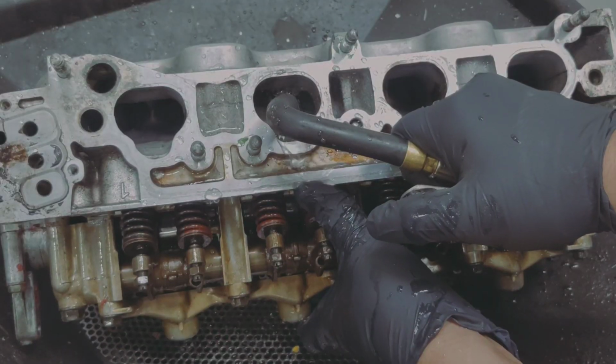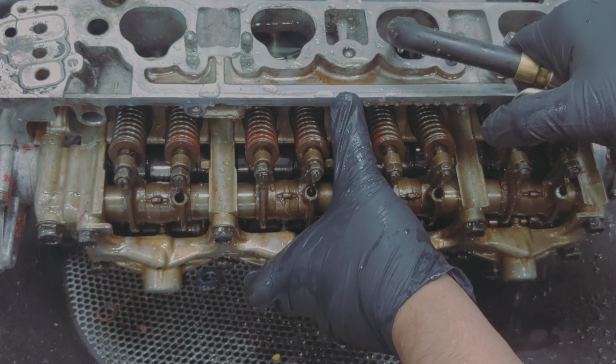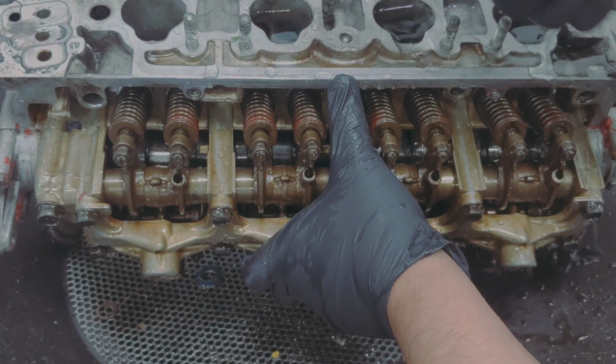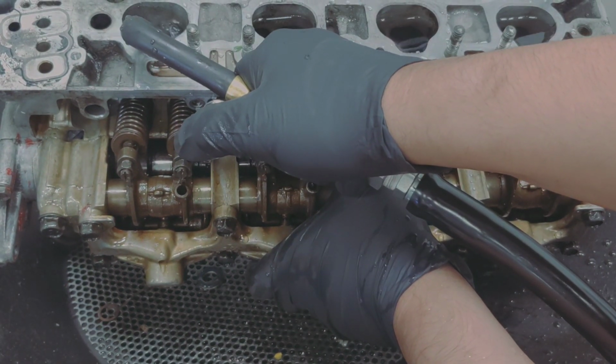First thing I did is back out the valve lash adjusters all the way so the rocker arms would push on the valves to make sure the valves were as seated as they can be. Then I filled up all the intake runners with water. It's kind of like a leak down test, and you let it sit. Three of the runners were fine. They held water. But the runner on the cylinder that messed up just leaks its ass off. The water just pours out.